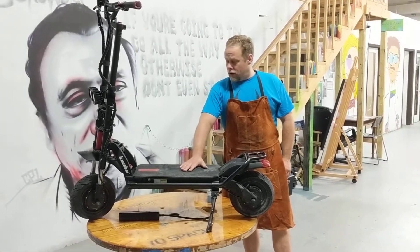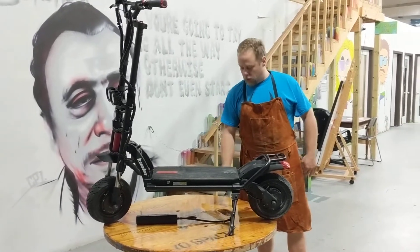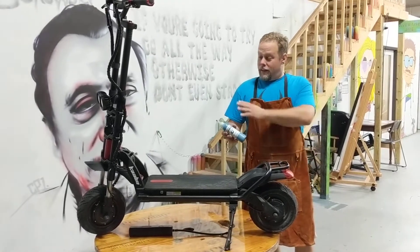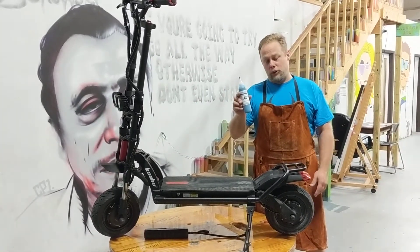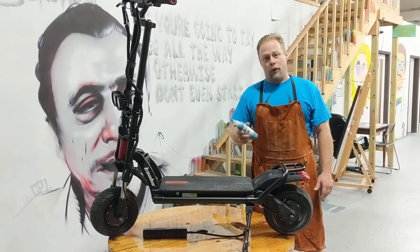This is going to be an 11-inch tire. It's going to require about four ounces per tire, so we're going to use an eight-ounce bottle and put in about half of each. This is a really fast scooter — it goes about 50 miles per hour — so we've chosen the blue Armadillos Extreme sealant. This is made for high-speed protection and is the top of our line.